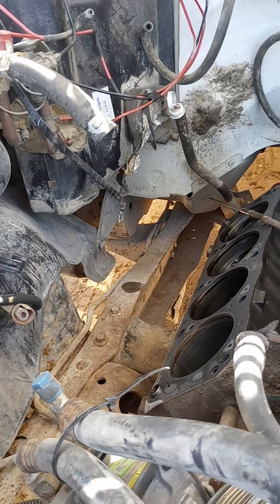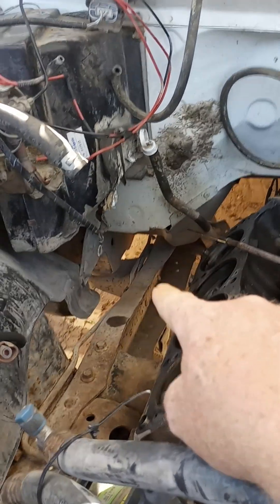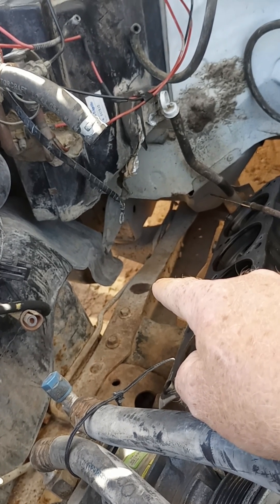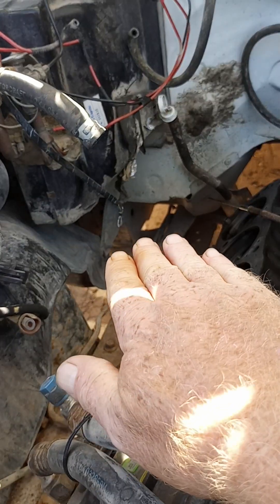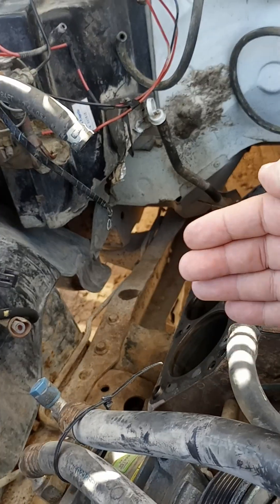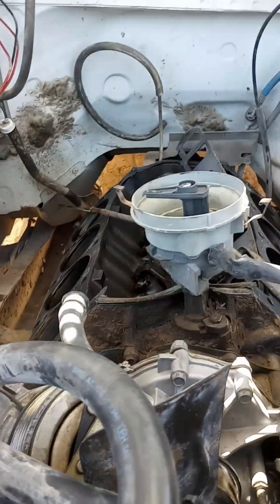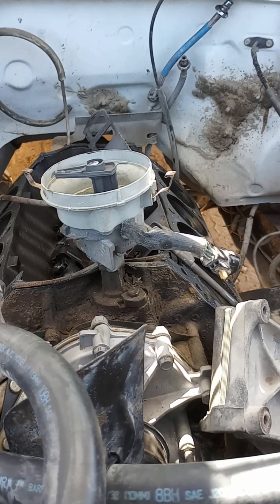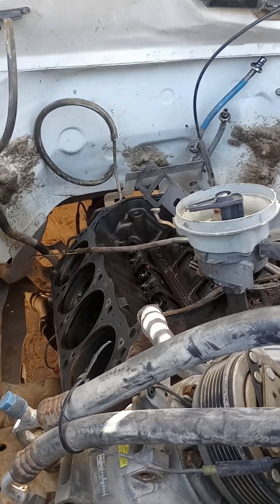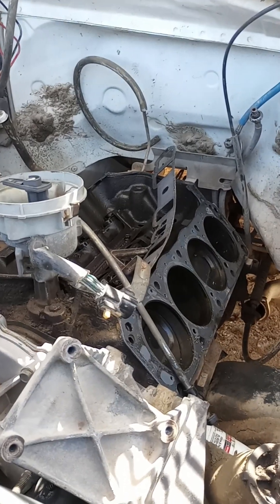What I'm talking about is right below where the firewall meets the toe panel, straight down in front of that body mount — cutting the frame and Z-ing it. This whole front section will get raised up three inches from its stock position, then it'll all get boxed in. The 302 that's in the '59 will bolt right in place of this 351. This truck looks like it has a C4 back there, which surprised me — I'd have expected a C6 on a 350.